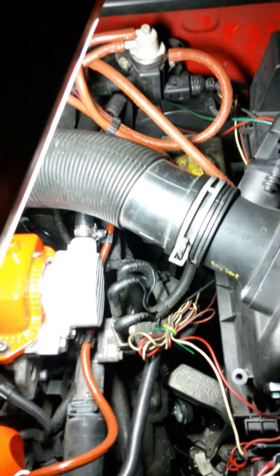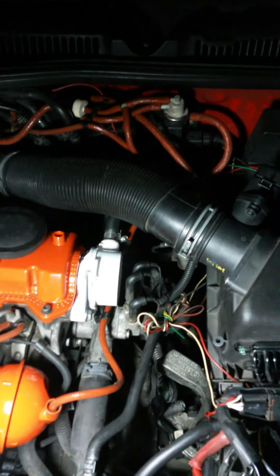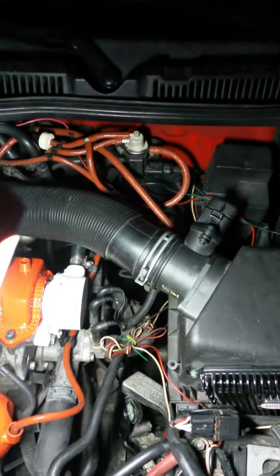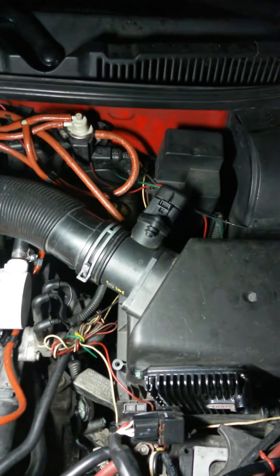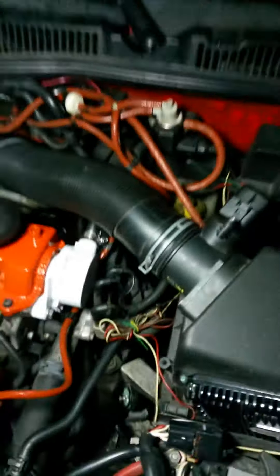I got my vacuum pump replaced, made it look pretty, got it on there and it helped. Check your outlet on your vacuum pump. I added a little silicone to mine — on the outlet on the back side of the outlet, on that press fitting — in case it were to leak. This one was tight, so that's just extra insurance.